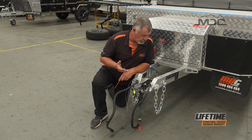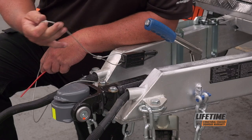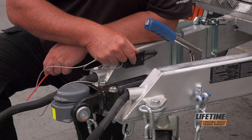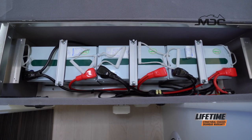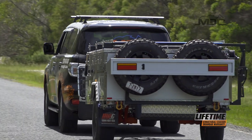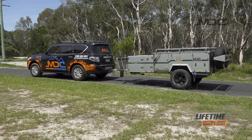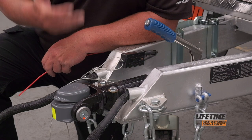This is done in a very simple way — with a switch and a lanyard. Basically, if your trailer disconnects from the vehicle, it pulls out a pin and two contacts come together, using the power of the onboard batteries to supply the electric brakes and pull the trailer up. It's meant to hold it there for a certain period of time to be qualified for sale in Australia, so it's a must-have on trailers over a particular weight.